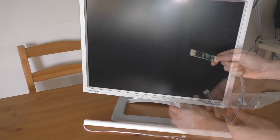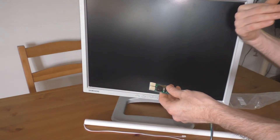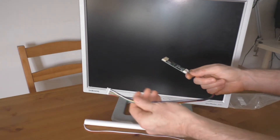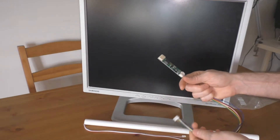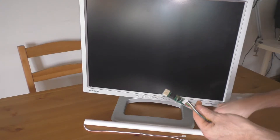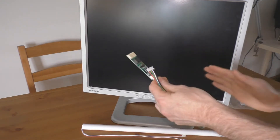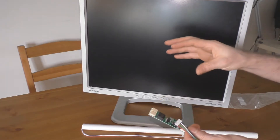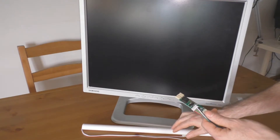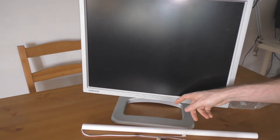You're going to plug the two LED strips on the bottom, remove the old inverter board, put this new one in, and it connects to the main motherboard. I should still have control of the brightness. I need to cut the two strips — on each strip you have to cut on a specific range because it's a group of three LEDs. I'll confirm that from the kit instructions, then adapt the plug to fit on the board, and also remove all the CFL tubes. Let's do this.